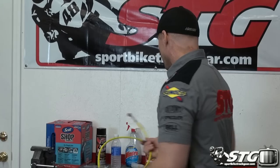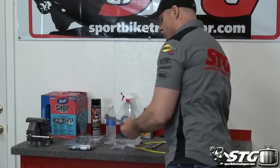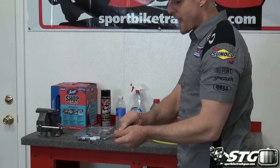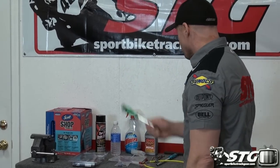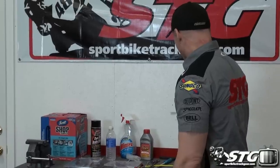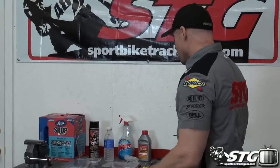Let's talk about tools. At the end of the day, this is a very basic job. The most difficult thing is probably bleeding the brakes, which we're going to cover at the end of this video. All you need is some hand tools — I've got three wrenches: a 12, a 14, and an 8. I've got a T-handle, a screwdriver, and my power brake bleeder. I'm going to use that to evacuate the braking system on the bike so I get a nice dripless install.